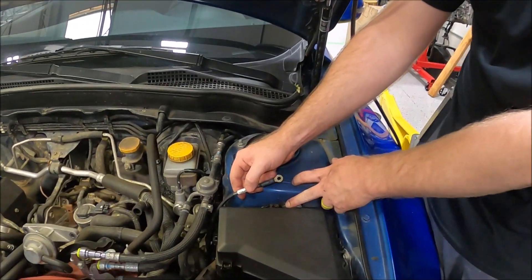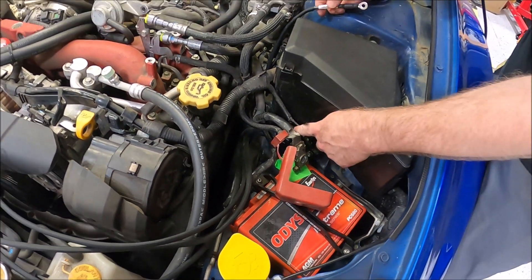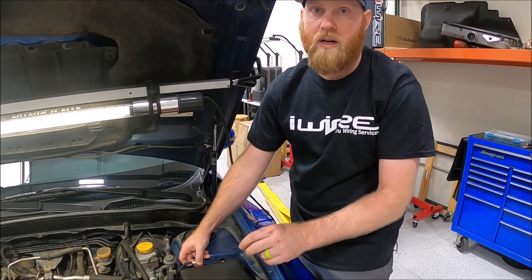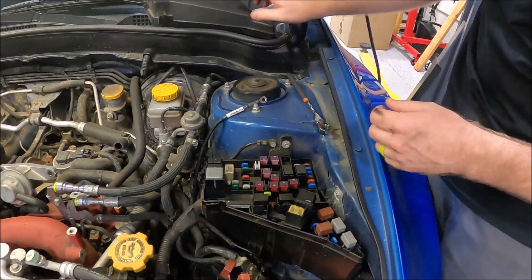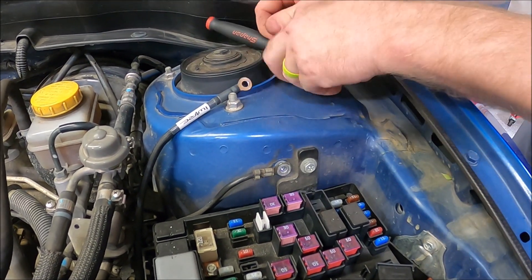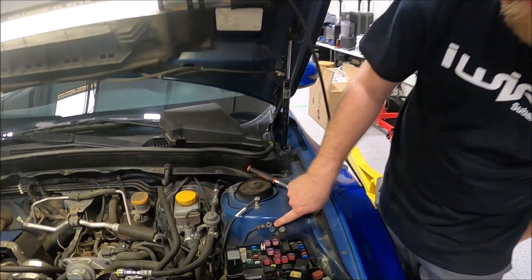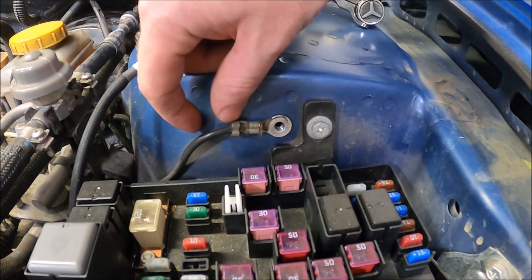This ground point is because this ground cable ties directly to the negative terminal of the battery. So instead of putting the ground on the negative terminal itself, we're tying into the negative terminal using the big points of the chassis. Step one is to tie it into wherever the negative terminal of your battery hits the chassis. A lot of times people will try to trust the threads to be the ground — I don't think that's enough because a lot of times they're dirty and they can be painted. So sand away any paint, like the factory did here, so the ring terminal is directly on metal. Really important for good grounds.